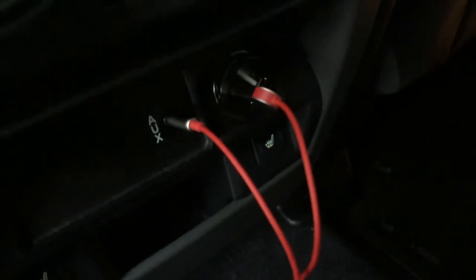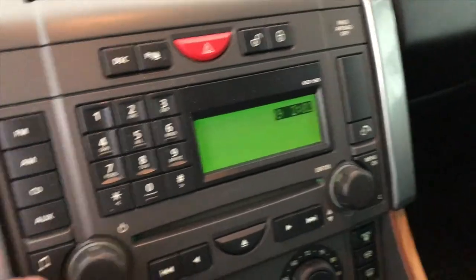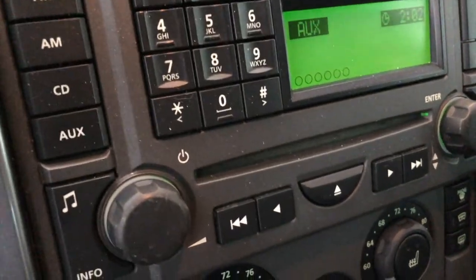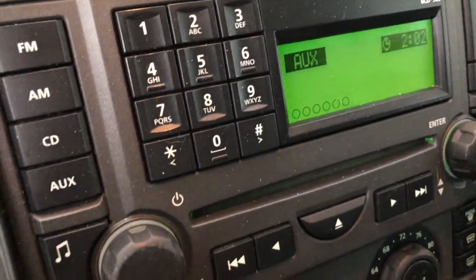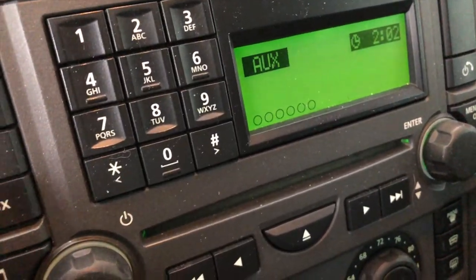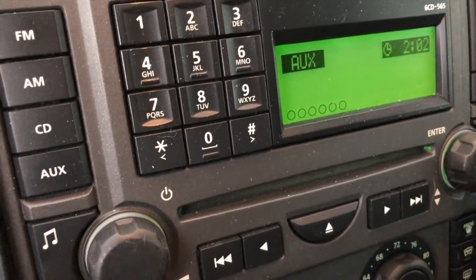Now I'm going to wait — you're going to see the little light starts blinking. Then we're going to turn the phone on. If you turn the phone on, you're going to have a Bluetooth that says Basis. Then you're going to go to your auxiliary and hit auxiliary. Just go to your Bluetooth settings, look for Basis, click it, hit the auxiliary, turn the volume up, and you have got Bluetooth music coming through your car.